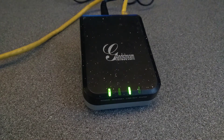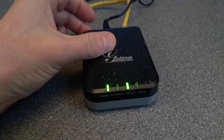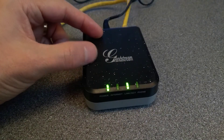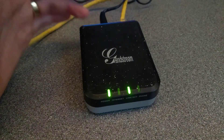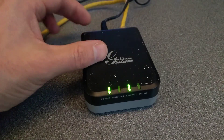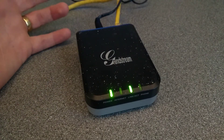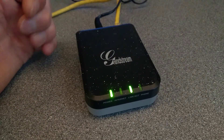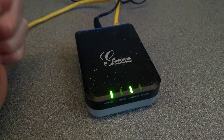Now you would need to plug a telephone in and use the instructions in the manual to dial a special number which will read out the IP address that this thing has obtained through your network. Or if you've got a DHCP server which will show you the leases or IP addresses it's given out, that might be an easier way to get hold of the IP address of this device.